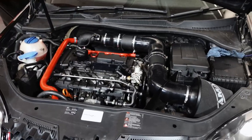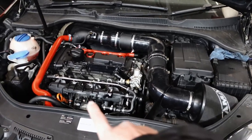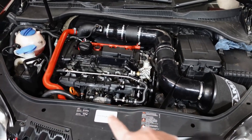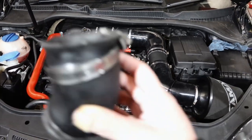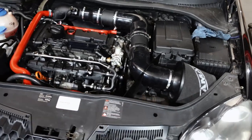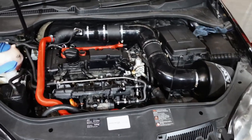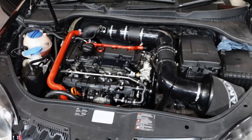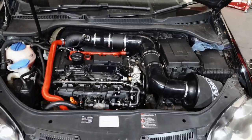With a new set of injectors in, the car started up first time on the key. There were a few leaks on the manifold to take care of: one on the intake air temperature sensor, one on the PCV delete, and the throttle body pipe wasn't sealing properly so we put a brand new one in. All of this is part and parcel of any KO4 swap if you do have problems like this. Let's get it on the dyno, do some base runs at the lowest boost settings possible, listen out for any noise from the engine, and see what we can achieve.